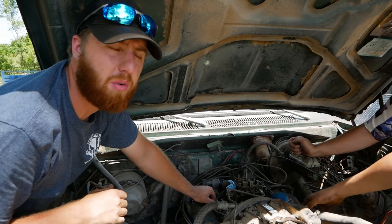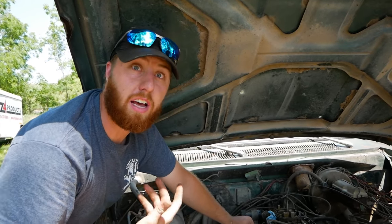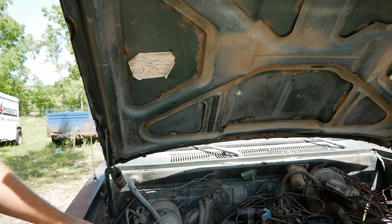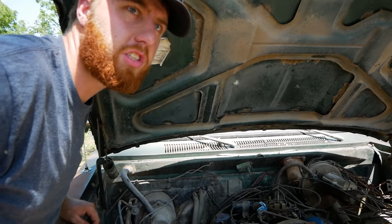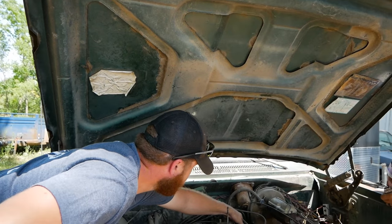Fuel slipping in somewhere, because we just closed the idle mixer screws all the way and opened the choke up all the way, and now it's burning the best it has yet. Is this fan making more noise than me? Also, our fan may have started working. The viscous fluid probably moved around enough. Works better.